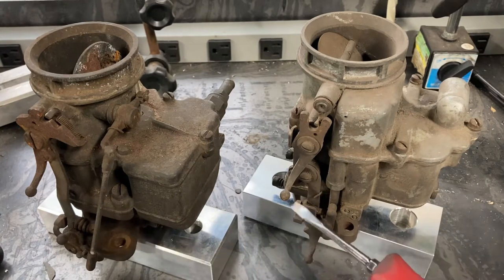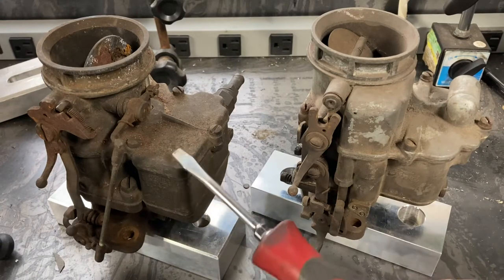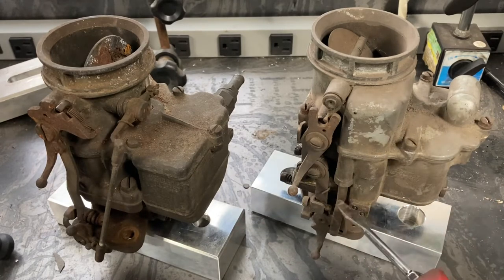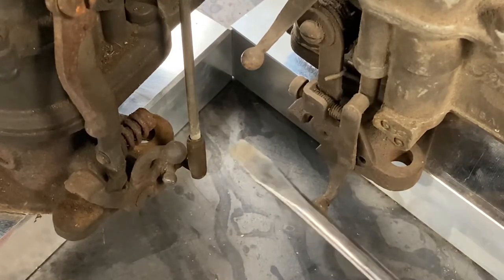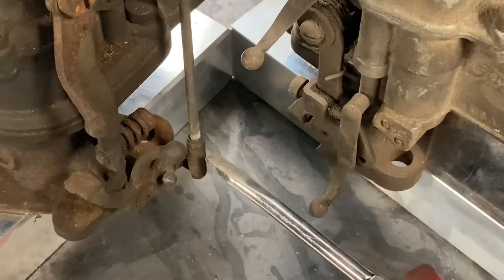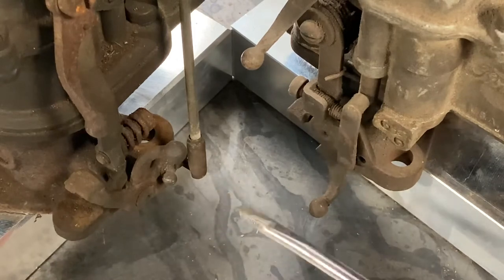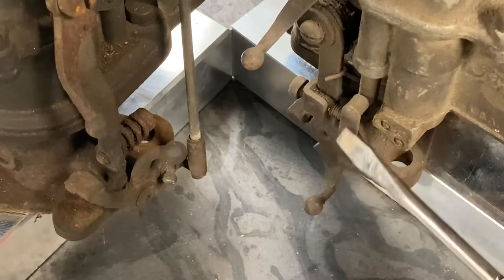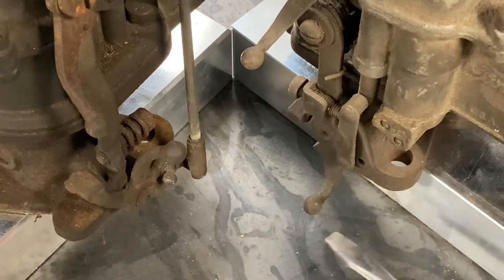You have your set screw for your idle. The only real difference from this perspective is that the accelerator pump on the Stromberg has external linkage, as opposed to the Holley which is all enclosed. The Stromberg has two positions for the lower connecting point of your accelerator pump — one marked W for winter and the other marked S for summer — just for a little bit more enrichment in the colder, denser air. Holley has a similar setup with three holes for three different settings, but they both perform the same.